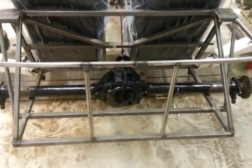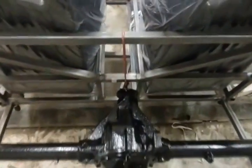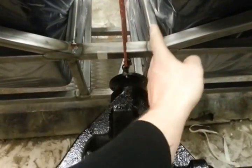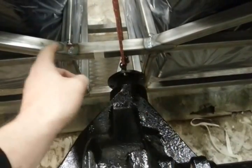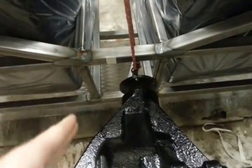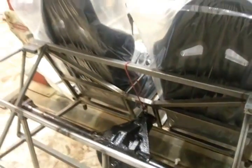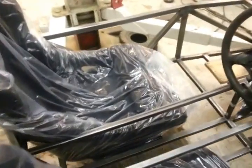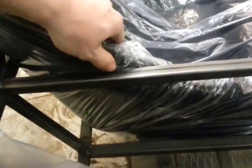I have put the axle here — it's a normal Volvo 740 or 940 axle. As you can see, the pinion is not in the middle; it's a little bit to the passenger side. That means I can actually move this side a little bit, and I will also move this as well because it is way too close. This means I will get at least two centimeters that I need for this seat, and I will be able to move the seat back and forth. Not everyone is the same size — he is a little bit shorter than me, and as you can see it is really, really tight, so those two centimeters will make it.